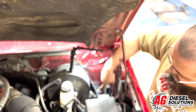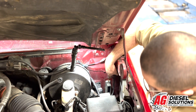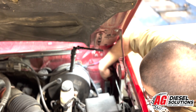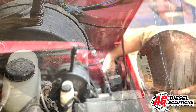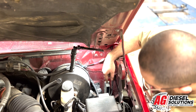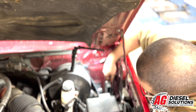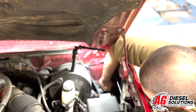Now that we have the wiring harness disconnected, we have removed the plate that holds the ECM attached to the firewall. On these older square bodies, the ECM pulls out into the engine bay from the firewall. If you want to, you can either remove the inner fender liner or just loosen it to help with the ease of getting down to these bolts. Once you have all that disconnected, just take the ECM and pull it out of the firewall.